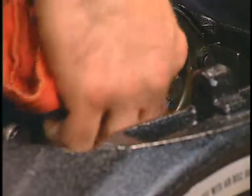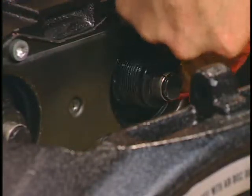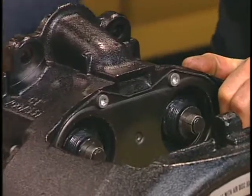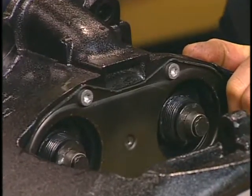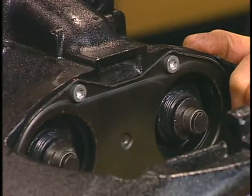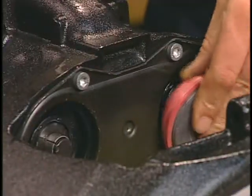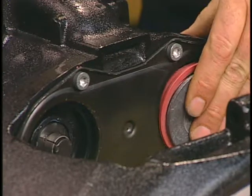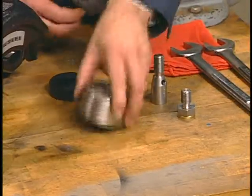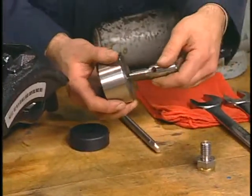First, make sure the tappet boot sealing seat on the caliper is clean and free of grease. Next, turn the shear adapter counterclockwise to fully wind the tubes back in. Place one tappet and boot assembly on the head of one threaded tube. Now, assemble the required tools.